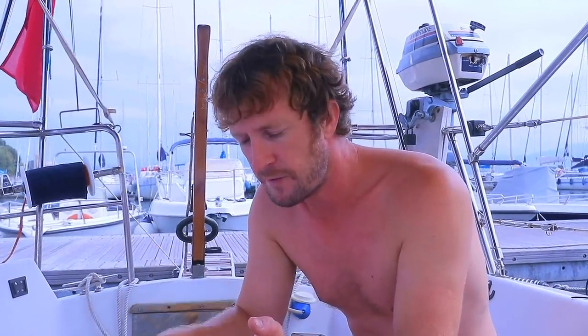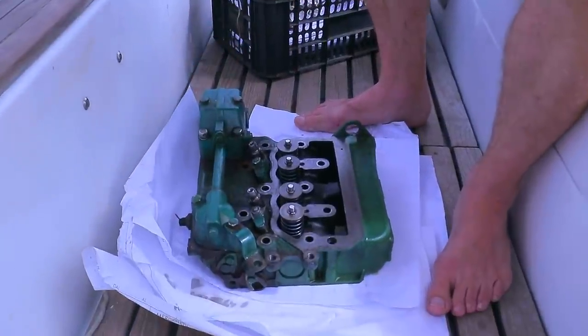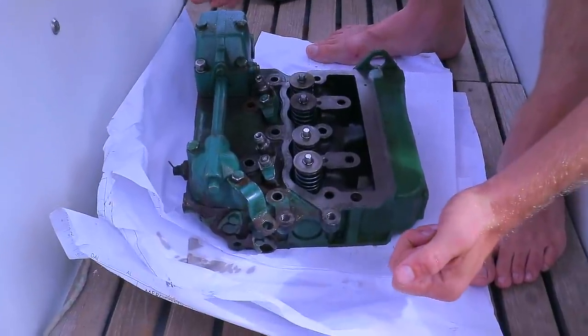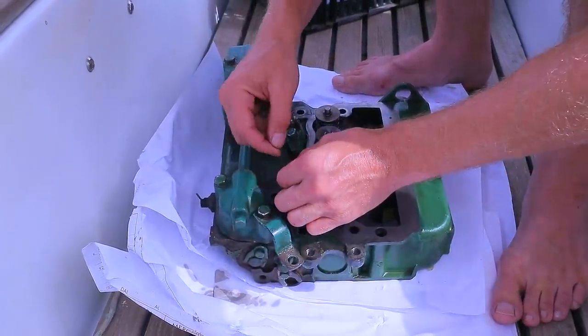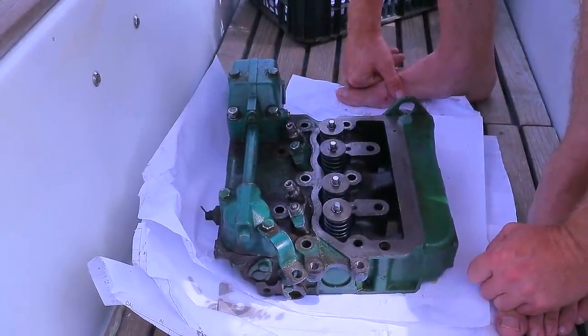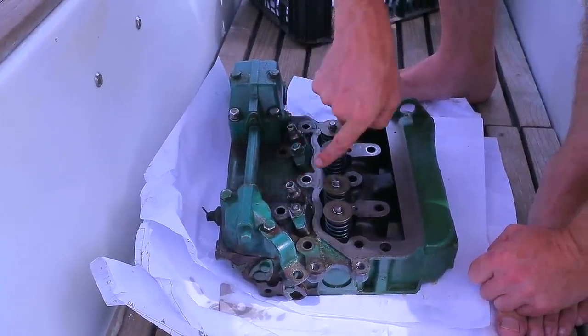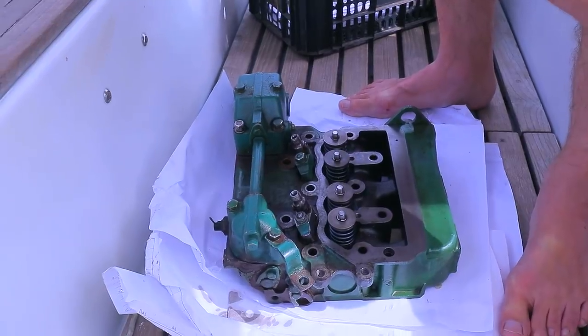Let's get this engine fixed! I removed the injector and rolled it in paper, and I also covered the other injector in paper so it was nice and clean. When they brought the cylinder head back, the first thing I saw was that both injectors had dirt in them - they'd removed the paper and allowed dirt to get into the injectors, so I wasn't happy about that. I cleaned them out with paper towel and then I noticed straight away there was a problem with the reassembly - this injector is facing the wrong way. I'm going to have to remove it and reposition it before refitting the cylinder head. This is part of the reason I struggle to get other people to do work for me; next time I'll buy the special tools and do this job myself so I know exactly how it's been done.